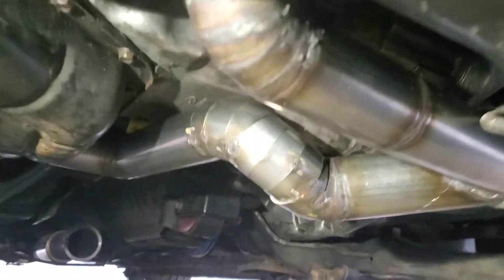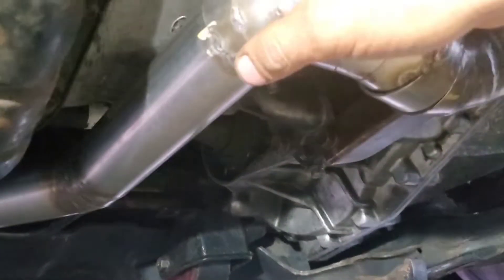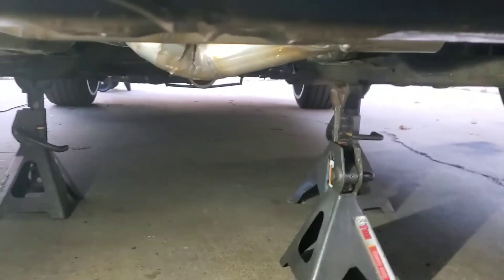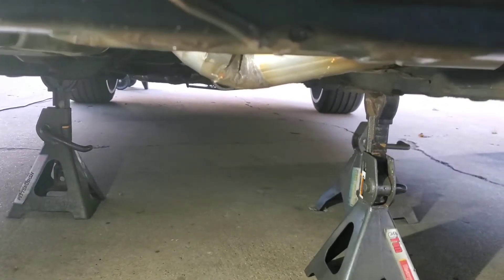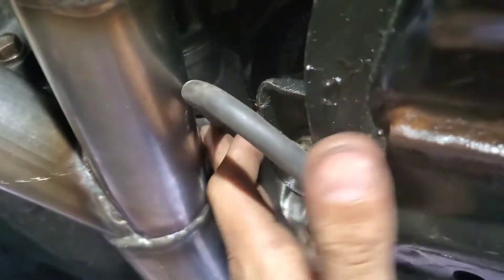Alright guys, I know these are not the greatest in the world, but I just want to make it work. She's solid, so I can start welding this and then start doing some pipe cuts for the two and a half inch to go up for the turbo. It hangs a little bit, nothing crazy, and still have room for the heat wrap to go around it. Hopefully this flows better. Then I need to figure out the O2 sensors — I need to figure out where the hell I'm gonna put those.